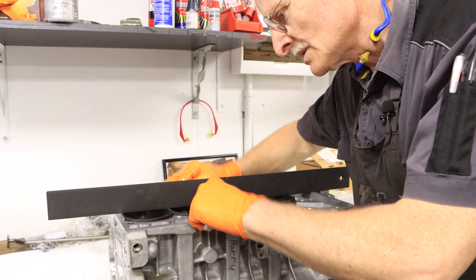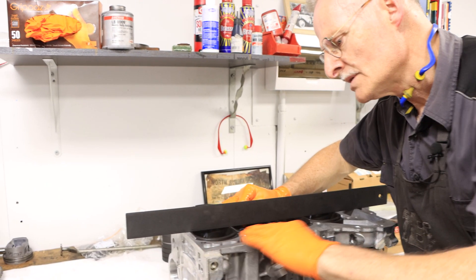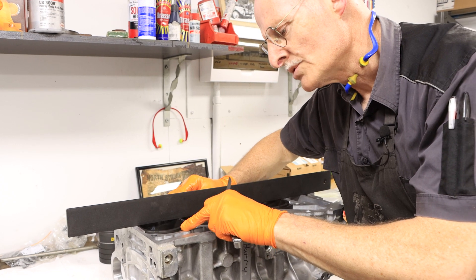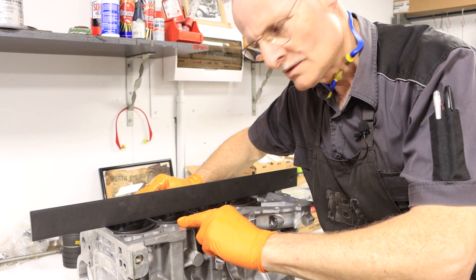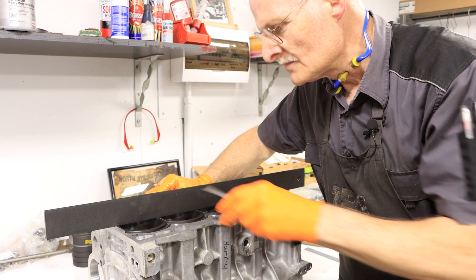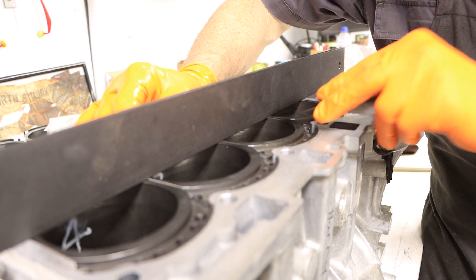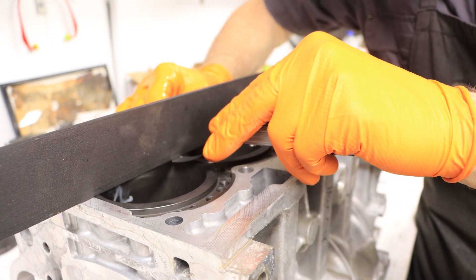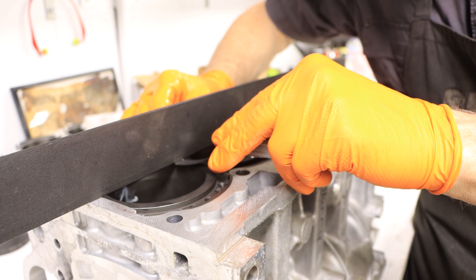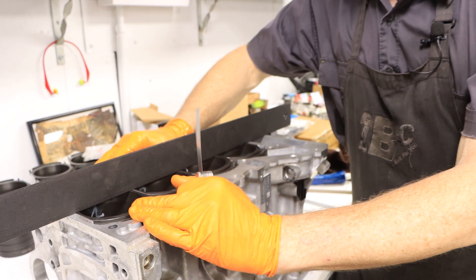Now that they're down, we'll finish bore and hone the cylinders to the correct size for the pistons being used in this engine, and then the deck will be machined down so that it's all nice and level. We've allowed about 0.2mm protrusion on the liner so that they'll all clean up and we take minimum amount of aluminium off the deck. I can't get two and a half thousandths of an inch feeler gauge between the liners, so I'm pretty confident they're all down evenly. That one's slight — I can get a little bit in there but it's hardly anything. Two and a half thousandths is quite a small amount. I think this liner is possibly just slightly shorter.